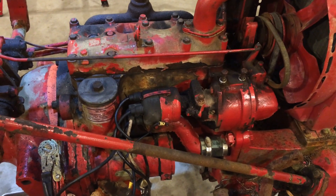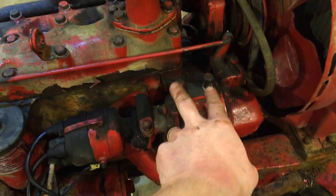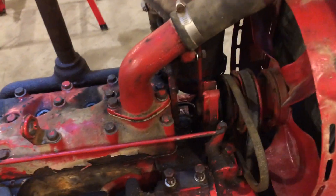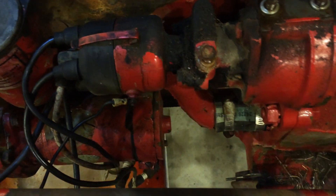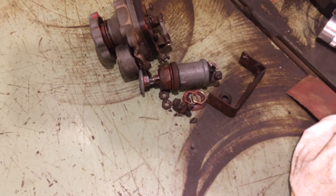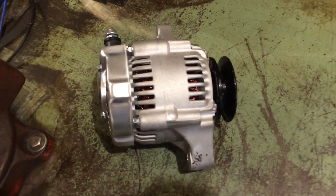Okay, I got back on task. Went ahead and pulled off all the wiring — got everything out of the dash and all the wires off. Pulled the generator and voltage regulator off in one piece — two bolts hold the bottom of the bracket, and the upper generator bracket comes off at the upper water pipe with one half-inch head bolt. The coil comes off with just one bolt. So pretty much the biggest part of the electrical system is laid out right here. I'm going to reuse the light switch and the push-pull switch — both tested good. Next step is fitting the alternator up there and starting to fabricate the bracket.